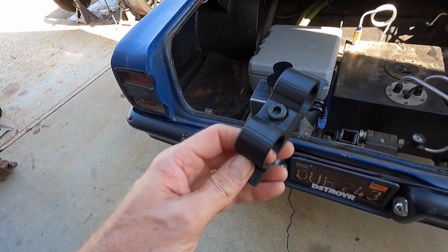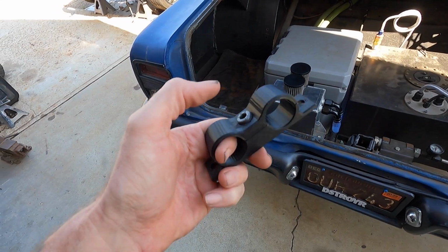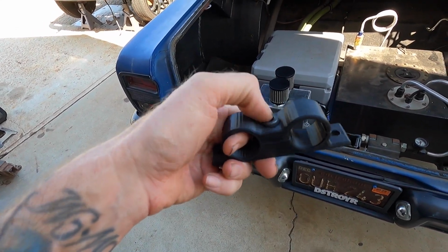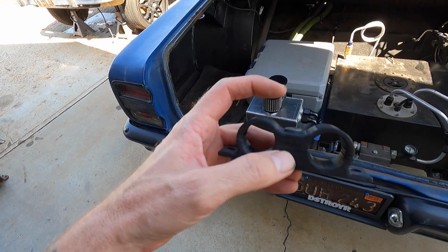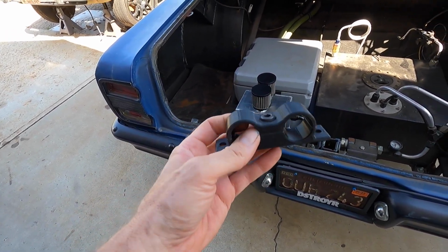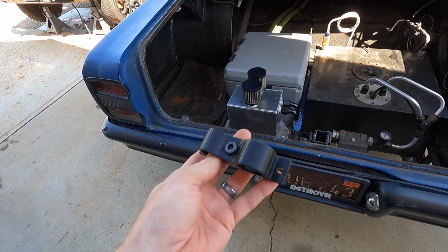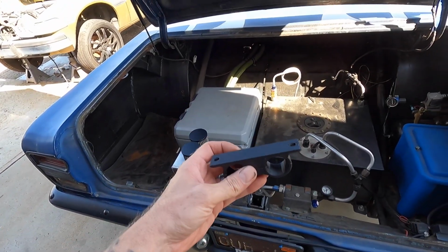It should start melting around 150, maybe a little lower than that, it might distort. And then I have the threads actually modeled in here, which is kind of like a natural nylock because it's kind of hard to turn anyway. And then I figured there's not a ton of load on the line, so we're going to see how well that works. And then just two quarter 20 little screw guys, and they're mounted pop, pop, pop.